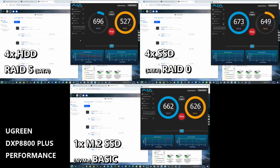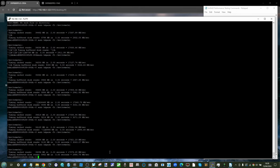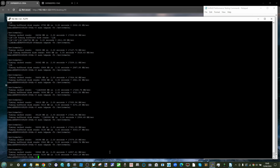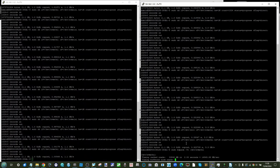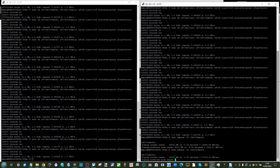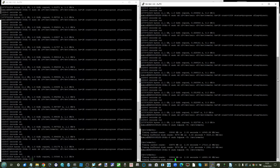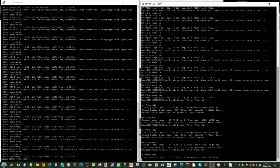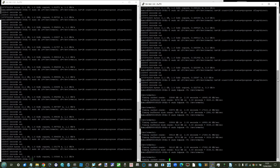So from here I decided to move over to SSH and investigate some of those PCIe lanes just a little bit. Before I went into any great detail, I just decided to run some cursory performance numbers in SSH using PuTTY on the NVMes. On the first NVMe in slot 1 on that Gen 4x4 slot, I was able to achieve 4.3 gigabytes over 3.2 gigabytes read-write, and that's on the first drive with a 1 gig file transfer. Again, transferring data between them, however, I was hitting performance numbers of just 1.1 to 1.2 gigabytes per second, which was much less than I expected.